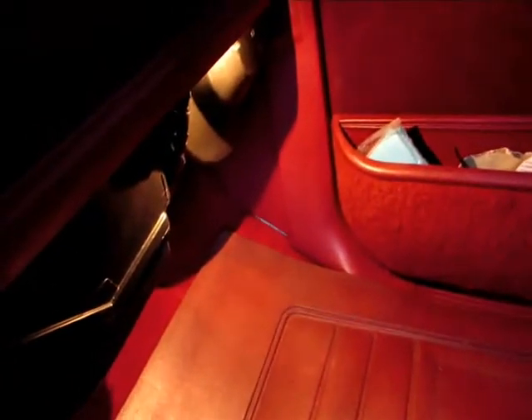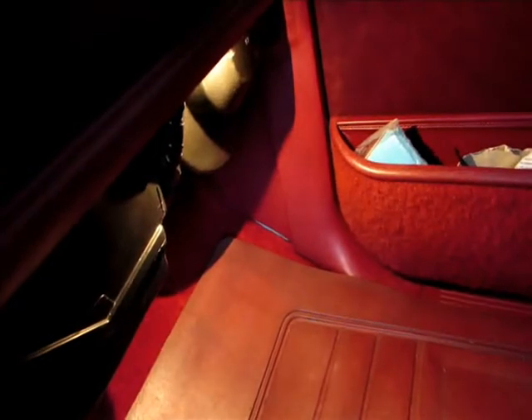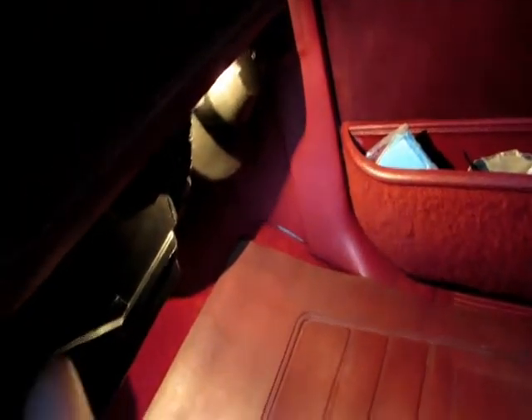Took the blower motor out again because I kept getting a scratching noise. Those case screws are so stripped but I managed to get it in and out. I found like three leaves banging around — they were flying around hitting the evaporator. The noise stopped after that, so the leaf was pinned up against the evaporator. There's also another actuator right there in these trucks.